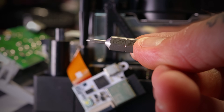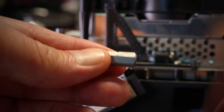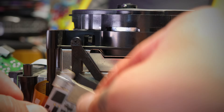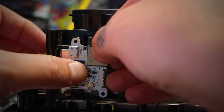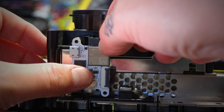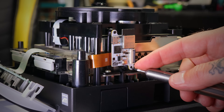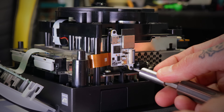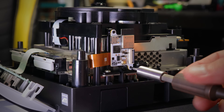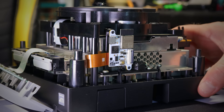Let's take our brace — there's a spot for the extra screw that we're going to cover up, which is nice so you don't lose it. Go ahead and install the bracket, place it, grab a screw, seat it, and screw it in. Grab your other screw for the other side and attach it. Now grab a Phillips 00 bit, because these are eyeglass-size screws to mount this to the bracket. Find your mounting holes, line everything up on the board, and attach it with a tiny little black screw — righty-tighty that bad boy right into place. This is the cleanest mod ever.